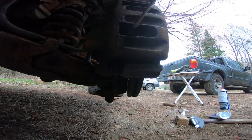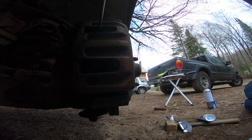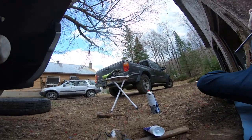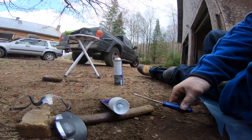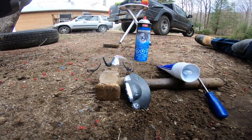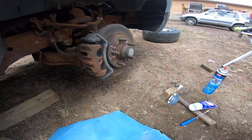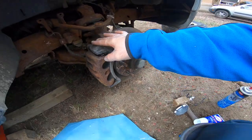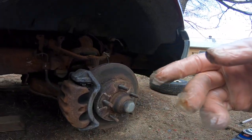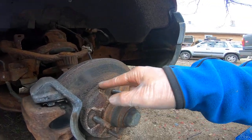The other side's done. Get your screwdriver in there, but don't put a lot of silicone on - just a little, enough that it slides. Now, before I did all that, if you don't have brake cleaner - doesn't matter what brand - get yourself brake cleaner. That's how I found out this bracket is actually fairly new, so these brakes are less than a year old. That's telling me I'm not going to bother putting on the other rotors - the rotor needs to be replaced at some point, but I'll live with it for now.